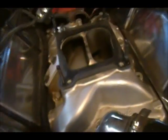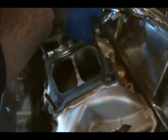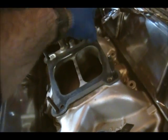Put mud on the walls. I set the door in the apartment. I have a little lead time now. I want to start working on taking a carb apart. I removed the carburetor. I'm looking at the base gasket, and it doesn't appear to be torn in any way, but I am going to replace that.